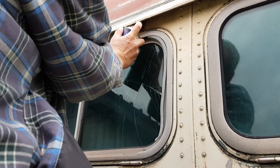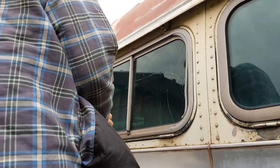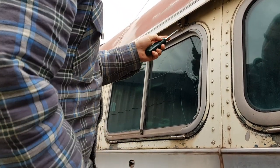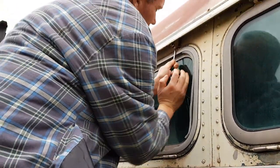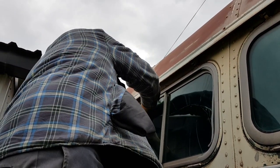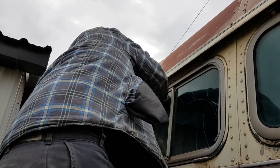So to get a silver side window out, first you need to free up these rollers. This is your emergency exit for passengers — these little rollers are supposed to pop up when you push the top of the window out. They're quite often seized from sitting, so I've just lubed them up and I'm trying to work them free so I can pop out the window.